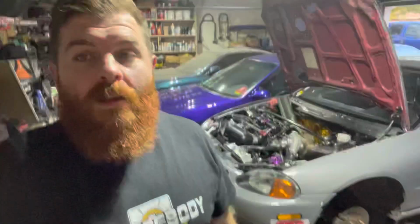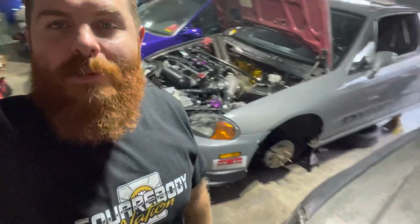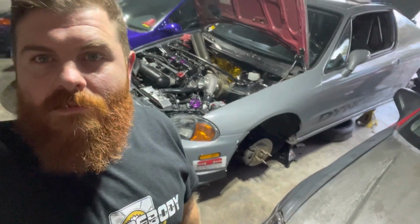All right, well, apparently somewhere along the line, the battery died, the brand new one. So got to figure out where the drain is for that, but put a battery tender on it. So let it charge and try it tomorrow or something. So had some battery problems, but hopefully sorting them out. Got some kind of electrical drain or something. Hopefully it was just the trunk light that was on all day yesterday, but this is what I meant about it spinning. But it's running. Maybe we'll drive it today, who knows.